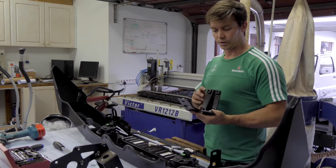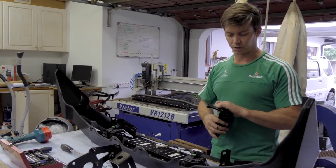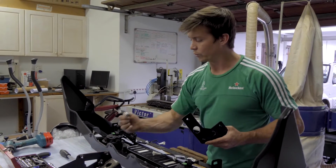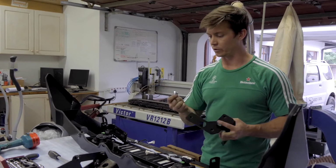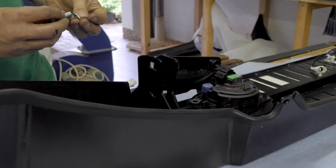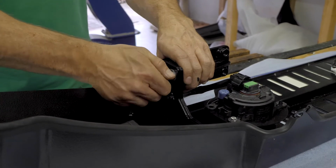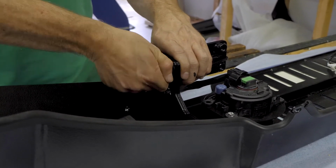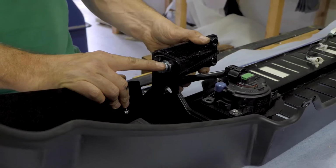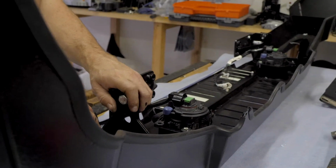Okay, we're just going to assemble the top mounting brackets to the bumper. This will just assist us in assembling the whole bumper onto the vehicle. For this here, we're only using your 4.8 graded bolts. Okay, we're only going to loosely fit these, as you want to have a bit of play and adjustment while lining this up on the bumper with the rest of the body of the vehicle.